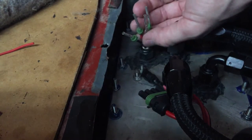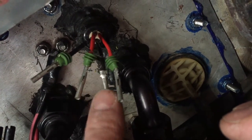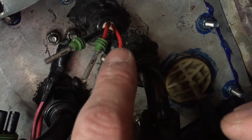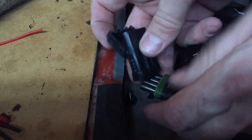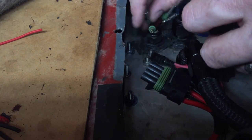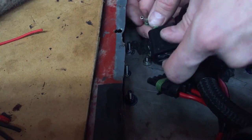If you look here, I've got all these ones done, all crimped on. I'm missing one of those rubber gaskets — I couldn't find it — so I'll go without it. I've got them all crimped on with the rubber seal on there, so now I just have to line them up with the correct spot on the connector. I'm going to double check — they've got to go on that way — so I'll start red, black, red, black, red, black.